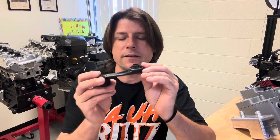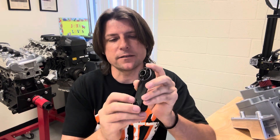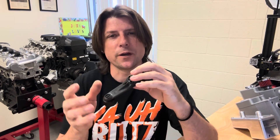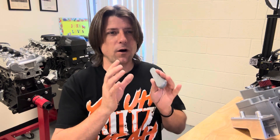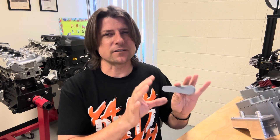Another new product I'm working on this week is window cranks. I've had a lot of requests for these over the years, mainly because the plastic splines on the inside of the factory plastic window crank strip out over time. A lot of this has to do with the window tracks in older cars becoming sticky, requiring more force to roll the window up and down, causing these things to wear out, break, and strip. I'm not really trying to reinvent the wheel with a window crank — I would like to come up with a solution that fits the car, doesn't look out of place, and doesn't look like some gaudy billet thing up against a standard interior door panel. Machining billet parts for interiors is always tricky because while in the engine bay you want things flashy and standing out, on the inside of the car keeping things as subtle as possible is always best.